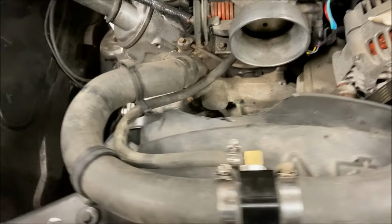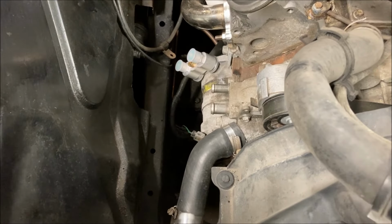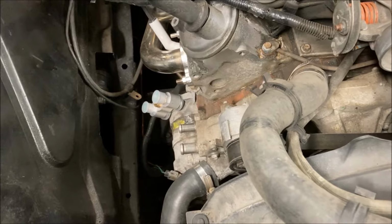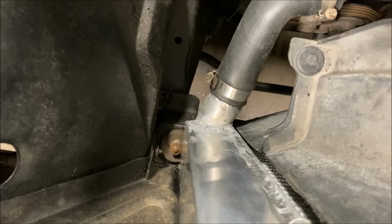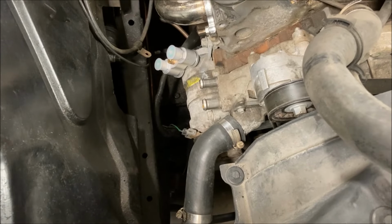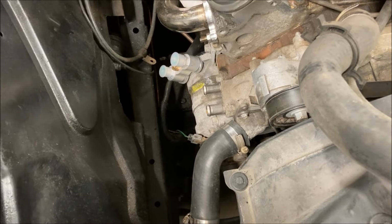And that is about it for the cooling system, except for the heater, which will be something I've got in mind. That'll be pretty cool. But I think the next thing I'll just have to do for now, I want to pressure test this thing, make sure that doesn't leak. So I think tomorrow we'll block off those heater outlets and pump this thing up and see what happens.